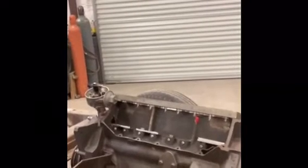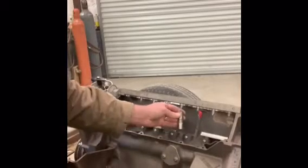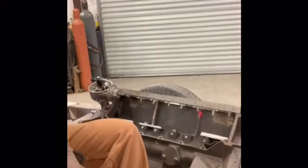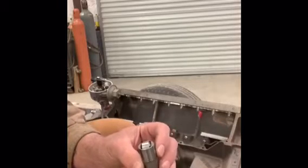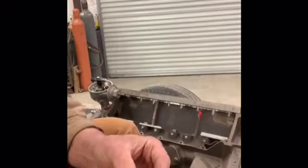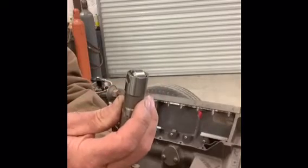So you can see here, this is a 4-cylinder 196 cubic inch International Scout motor, and the cam has been ground to accept a roller lifter. I needed a different profile on this cam. This engine is going to be spinning at a little higher RPM, and I needed different torque and horsepower curves in different areas than what the factory cam allowed.